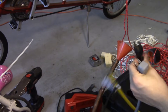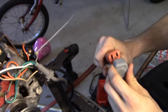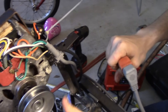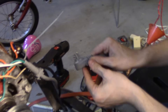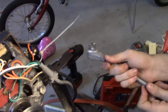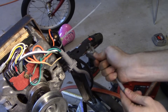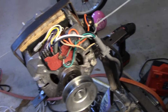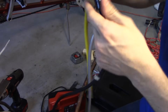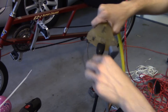If you unplug the wires — one connected to the capacitor and one to the motor — you need to be very careful, because the capacitor can be charged up to potentially 170 volts. I'll discharge it on the metal frame — there's just a little spark. That's why I keep both wires plugged into the splitter: it allows the capacitor to discharge through the regular windings when unplugged rather than holding a dangerous charge.